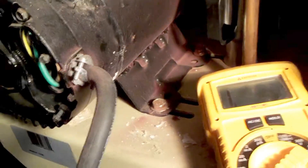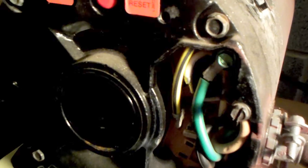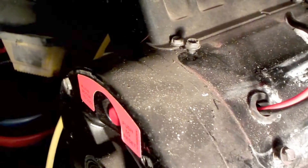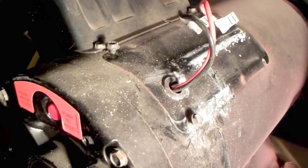I'm going to apologize in advance for the poor lighting - this isn't where I normally film, it's the basement of my garage. My air compressor died: I flipped the switch, it groaned, didn't come on, and tripped a breaker. I verified voltage all the way to the back of the motor. Under one of the caps I saw a whitish substance coming out - that's where my starting capacitors were. A starting capacitor gives your electric motor a little push whenever it's time to start.